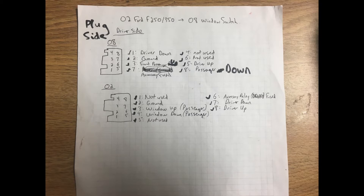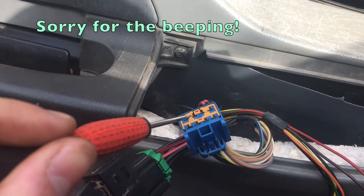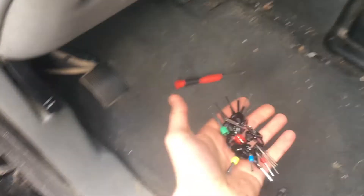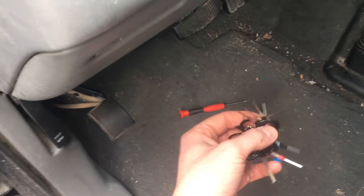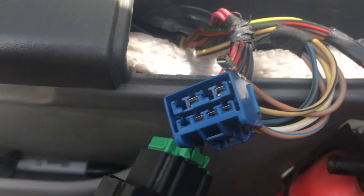This is the diagram — I'm actually going to show you where the pinouts go and what everything connects to, because a lot of people don't bother showing that. This is the plug side. First, take this little orange cover off. Then use a trim tool — you can get one on eBay or Amazon for about five bucks. Use the flat one, get it in there, and lift up the little plastic tab.